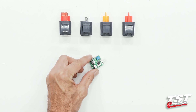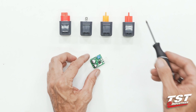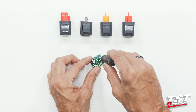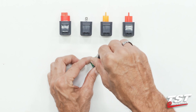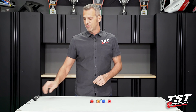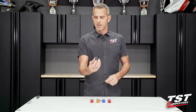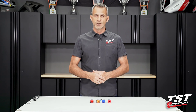In addition to plug-and-play ability and easy installation, we do also have adjustability built into this relay. If you strip off the gray cap, you'll be able to adjust the flash rate and fine-tune it to your liking — faster or slower. It does arrive to you preset to 85 cycles per minute like the OEM systems. If you feel the need to change that, you have that capability.